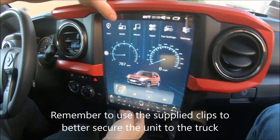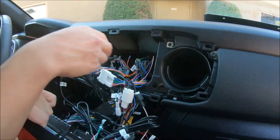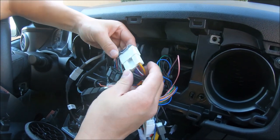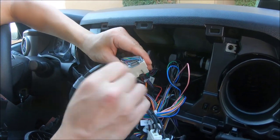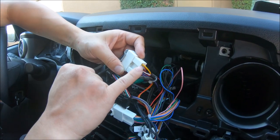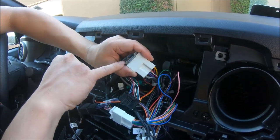On the back connections, one thing to note is when you're looking for the power connector with the thick yellow wire and the thick black wire, confirm that you have matching wires on the top pinouts — one for the yellow and one for the black.